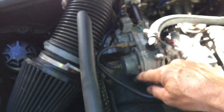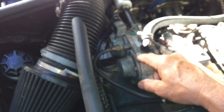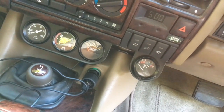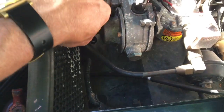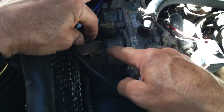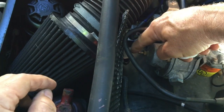The other quite common problem is the vaporizer or pressure reducer. Again, this is a Dream 21N unit - it's the high horsepower version. What can happen very commonly is the diaphragm inside the first pressure reducer can age and harden up, get affected by the LPG gas, and then your engine won't run very well. If you have an air fuel ratio meter inside the car, that will tell you your engine is running too rich when idling. The very common reason is the diaphragm is perforated, letting gas straight out into your inlet manifold via this vacuum pipe. If you put a little bit of spittle on the end of your finger and hold it over the end, you'll see gas bubbling out, which shows the diaphragm has ruptured.